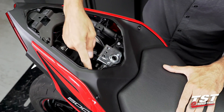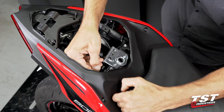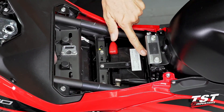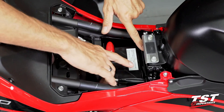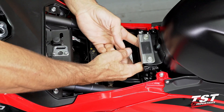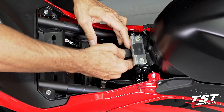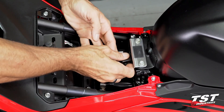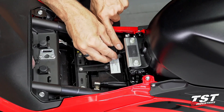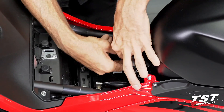Removal of the driver's seat is done via pulling on a cable pull right in this location under this shroud — it just has a ball at the end. Once you pull it back, that unlatches the latch. Right under this bracket we have the flasher relay, mounted via a rubber mount to a tab on this polypropylene piece. My method for extraction is to bend this whole assembly backwards and pull up and away. Then rotate it to find the locking element, press on it towards the harness plug, and that unlocks it so you can withdraw it.